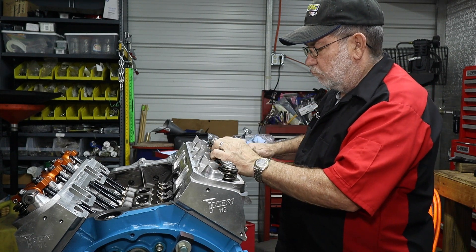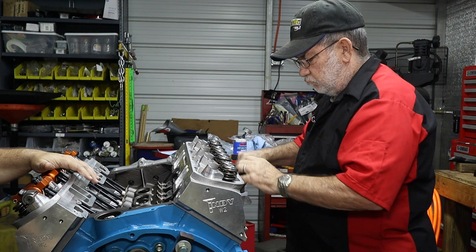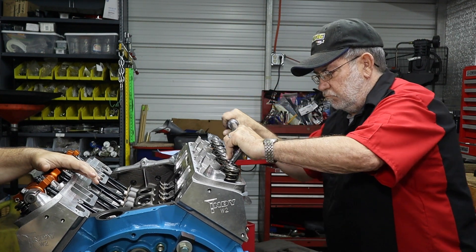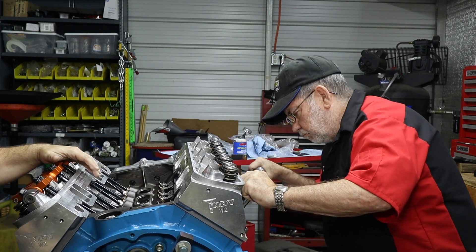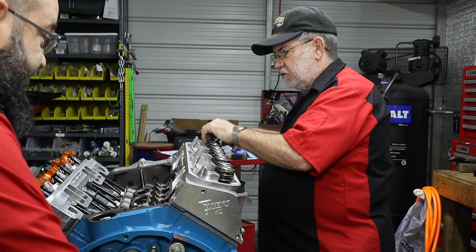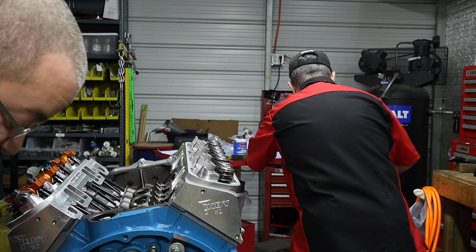Now I'll go ahead and do this at 65 foot-pounds. I do read the comments left on our channel and we get a lot of love from the Mopar enthusiasts out there. One comment we got from when we were torquing the crank was to put a paint stick under the wheel — sure enough, that's what we did today. Thank you for leaving that comment. It really helps ensure we're not moving the motor as it's torquing down, which might throw off the torque number. I'm just here holding that paint stick in place. It absolutely helps when we get to 95 foot-pounds.